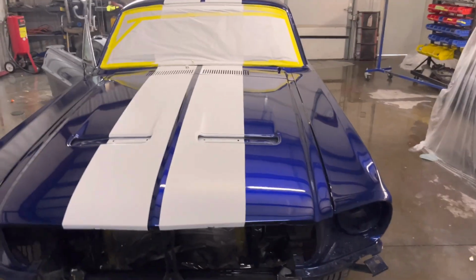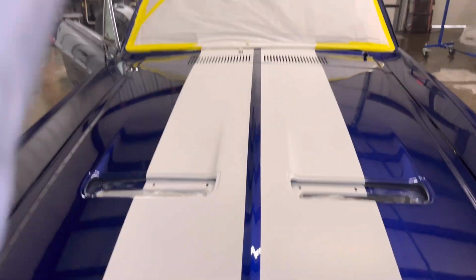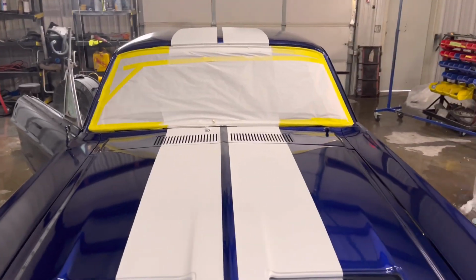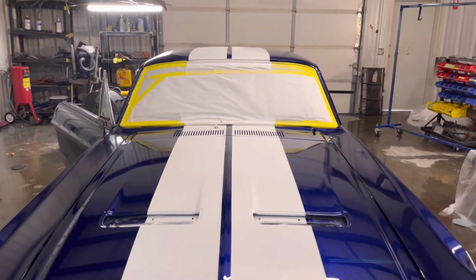But if I can't, unfortunately, I'm going to have to cover the blue back up real perfect and then hit it with some regular pearl in the mid coat or in the clear, preferably the mid coat. Now, the difference between mid coat,